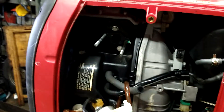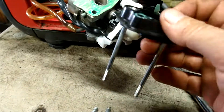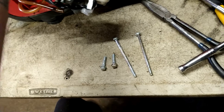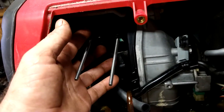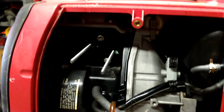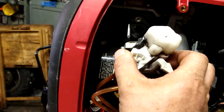Take these two eight millimeters off, put pressure on both of these and pull it out. Then you're gonna take these bolts out of this case — the kit comes with new ones. It just goes right back in just like that, then you're gonna go ahead and bolt that back up. It looks like that. I don't know exactly what they're planning on doing because that sticks way out the side of this thing — seems a bit too long. Maybe they've got you cutting off the bolts or something. I guess we'll figure that out. Put the carburetor back on.